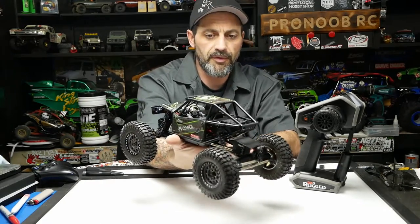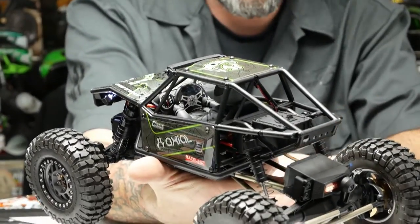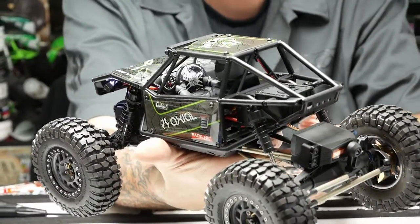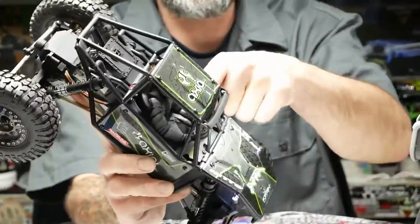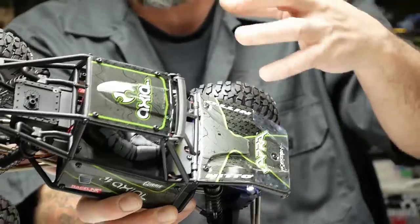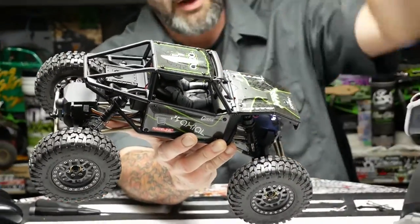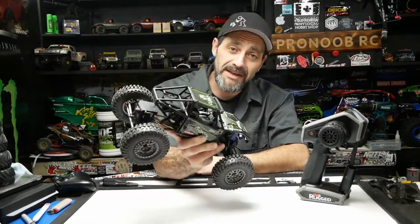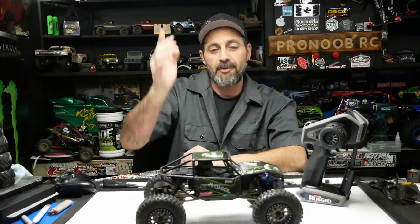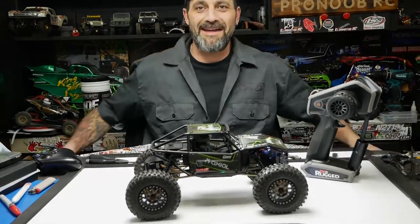Look at that interior, it's so dope. Love the way this one fit into it. Now that's an Axial SMT10 interior. You can pretty much use any of the 10 scale interiors. You have to do a little bit of work. You can see in the lower region here, we had to heat that up and kind of push it down around the top of the transmission. We'll get some close shots of the interior when we go hit the micro mount. I'm gonna shut up. We're gonna go over there and do some working.